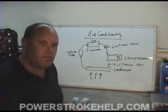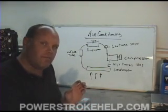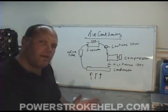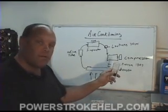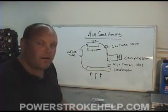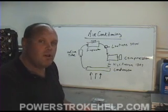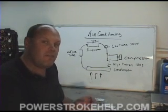Two things to make your air conditioning cold. A lot of people like to just add a can of Freon. Every couple of years, you want to evacuate the coolant system and get all of the old Freon out and all of the moisture that may have accumulated in there out. And if it's really bad, go ahead and replace the accumulator. Replace it with fresh Freon. But before you do that, replace it with a smaller orifice tube. This is a Factory Air number 38639 — 35 is the stock number, but 38639 is a little bit smaller orifice, which will get you down to around that 40-degree mark. This is especially good if you live in Florida or in the southern states or out west where it gets hot. This will help you considerably.